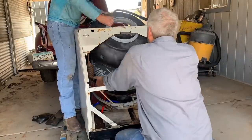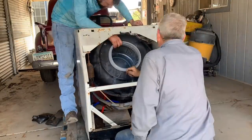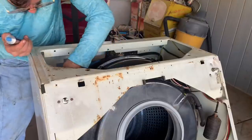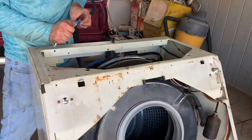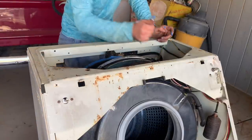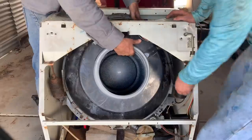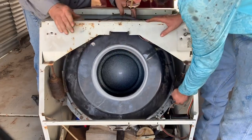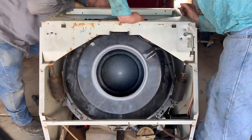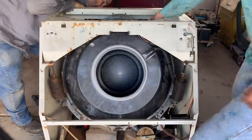What's kind of cool about washing machines is the outer barrel you're seeing me put on doesn't turn, but the barrel on the inside turns — it's cool how they were able to do that. Now I have the front half of the barrel situated in there. You can see that black gasket that goes around the entire outer perimeter is on the front half, and the back half is the mating surface. I know that gasket is kind of hard and there's no replacement for it, so I'm going to help it out with RTV sealant, which is what we use on cars. I'm pretty confident it's going to work fine because it seals under over 200 degree heat and under pressure in a car — so it'll easily handle this washing machine. Now I've got it in there and I'm hooking the springs back up.